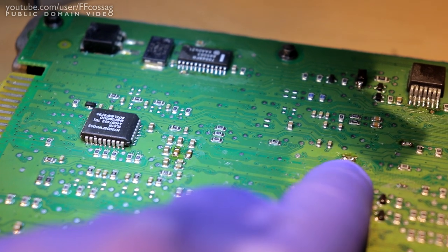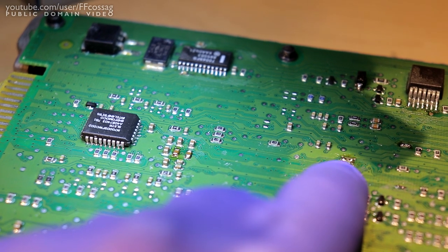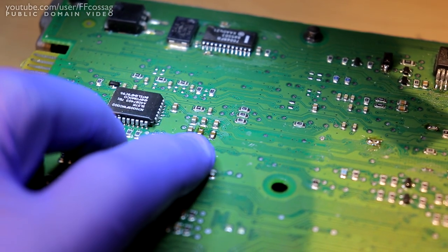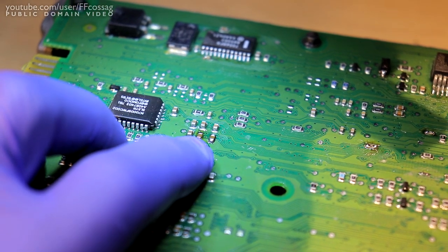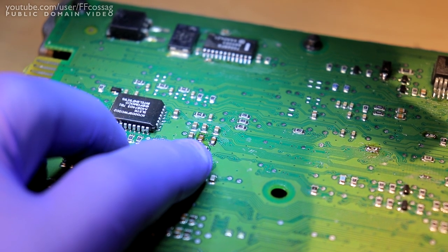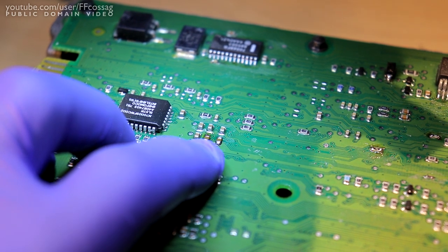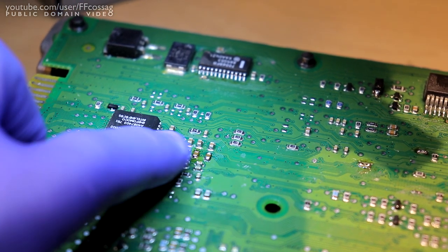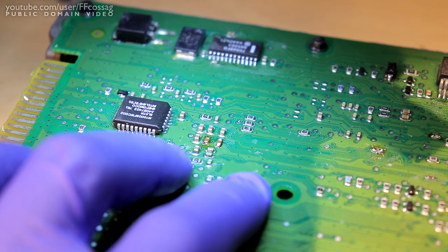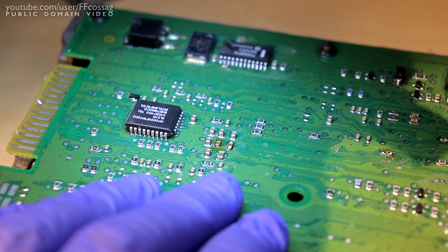It's a 39K resistor here, measures about 13K in circuit. The resistance is supposed to be about 60K across the coolant temperature sensor capacitor. If any of these caps are shorted, it's going to cause erratic sensor readings, because I think all six of these caps go to various analog sensors in the engine bay.